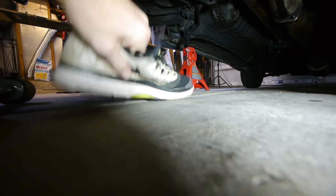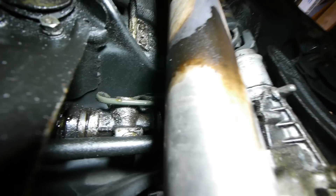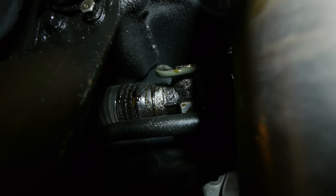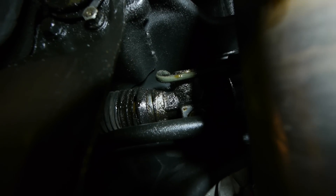Spider. Die. Yep, that is a hot mess. The power steering fluid is leaking from at least three spots on the rack and most of it is dripping right down on my downpipe. It's been making a wonderful smell for quite a while now.